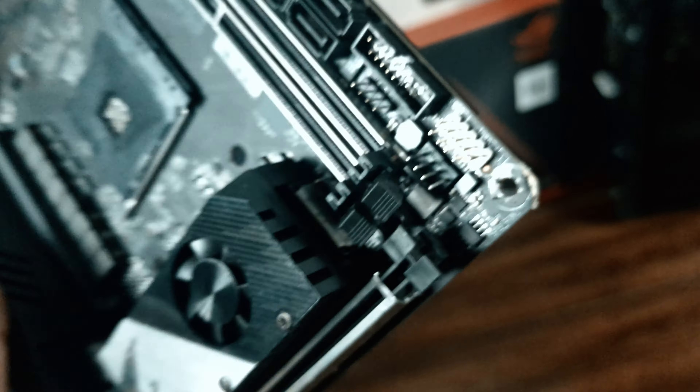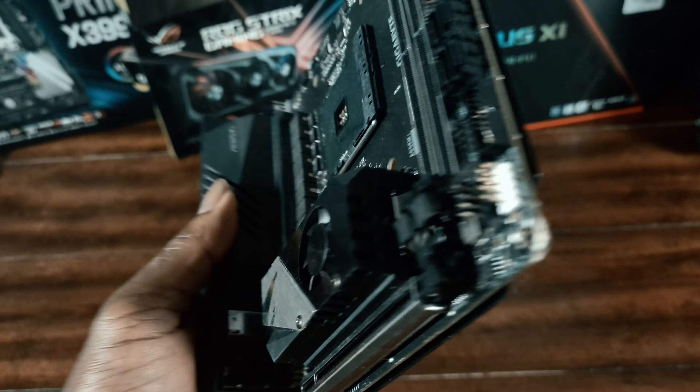At that time I had deep-dived into the potential issue with the motherboard. To get to the CMOS battery it's a little tricky because it's essentially underneath the VRM and the I/O shield on the side of the board. But even after putting everything back together and trying to use it with the 5800X and the RTX 3060, we still weren't getting video out — still getting a black screen. Popped the CMOS battery out — same results. I'm thinking you're going to need another board.